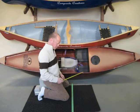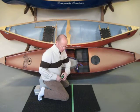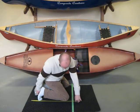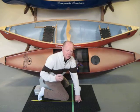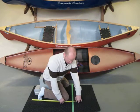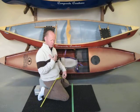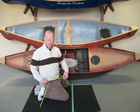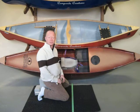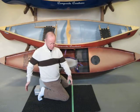What we will do is take that front measurement — it is roughly 2 inches in front of my kneecap for my comfort level — and I measure back behind me to the back side of my saddle or to a given area that I would like to have. If you are going to store items behind you such as lunch bags, you may want to give yourself a couple more inches. For myself, I like the bulkhead to be right behind the saddle itself. So for me, we are looking at 26 to 27 inches — I would say 26 and a half if I was filling in the actual page for the size of the bulkhead.